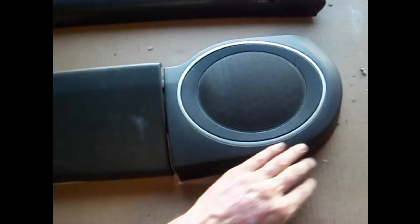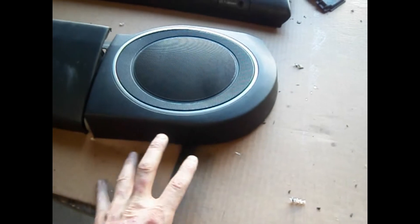How we're going to do the parts is pretty straightforward and simple. First thing we're going to do is recreate a top sheet. As the original parts went together like this, we're going to recreate this into a single piece. With that, I'm going to glass on top creating the overall sheet, including the edge round — this perimeter right here and this perimeter that I need right here. These are very important perimeters. I may even think about vacuum bagging them to get the detail as tight as I can get it.